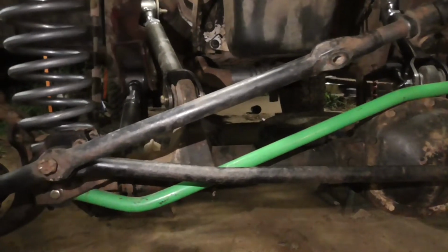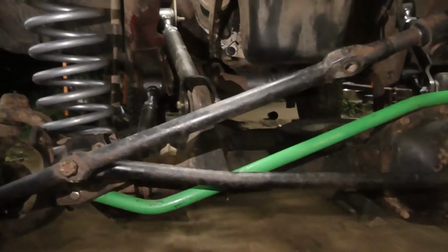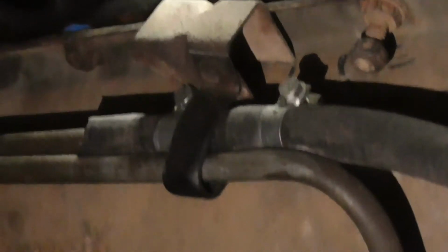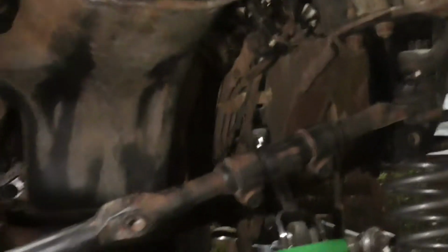The exhaust, I got a little U-connector right there. I'm just going to get clamps and clamp it down. I'm not going to worry about welding it right now. All this stuff in the front end is loose. The control arms aren't tight because I'm going to do that when I get down on the ground. I cut off all of my connectors for my trans lines, and I just used 2 fuel line clamps where I had them on the hoses, because the normal hoses were rotted, they were going to fall apart. That should hold. I'm going to carry an extra hose with extra clamps.